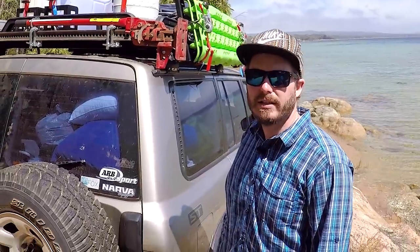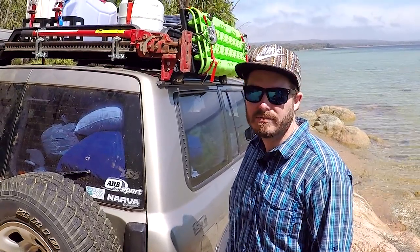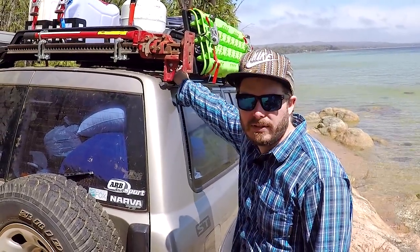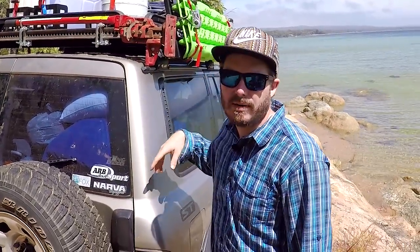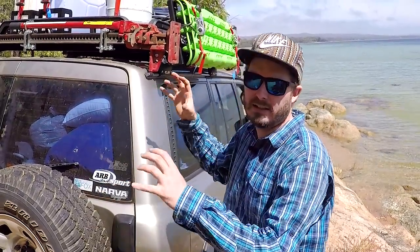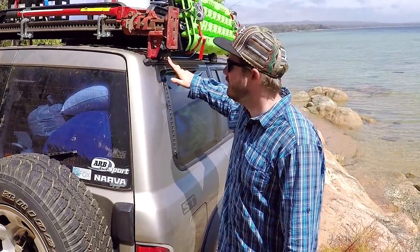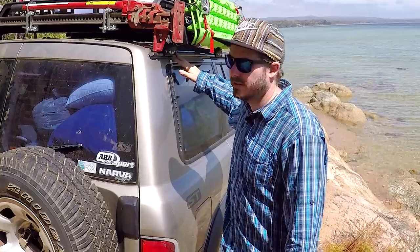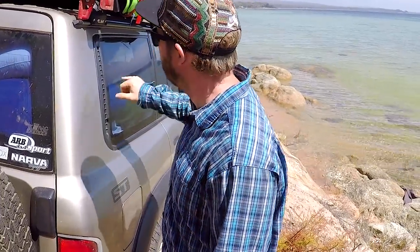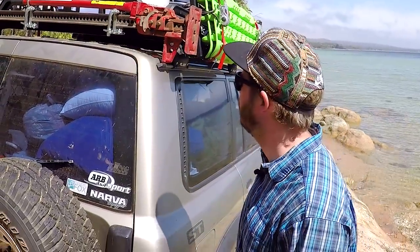As far as noise goes, it's a pretty quiet rack — there's no wind noise that I've heard. What I am hearing though is after about 500 Ks with all this weight up there, I think it's started to come loose in the mounts and I'm hearing a lot of creaking coming through the roof. I think I need to tighten up these Torx security screws, but I didn't bring my Torx set with me. Always keep the tools handy to be able to tighten and adjust it. I'm not even sure if it's there or where the tray mounts onto the roof bar that's making the noise.